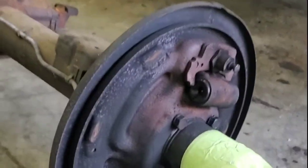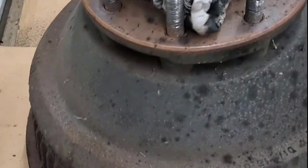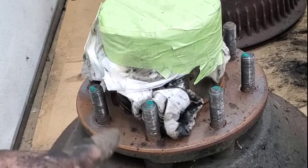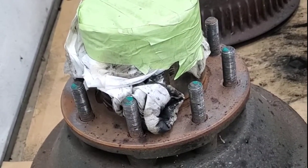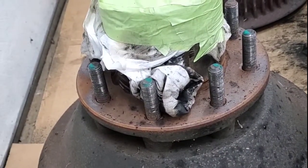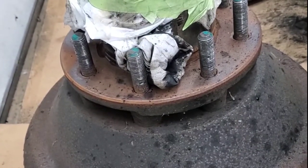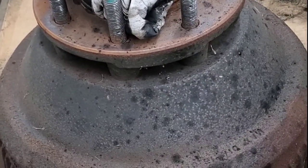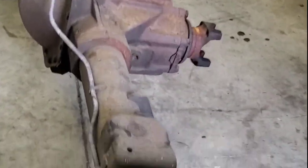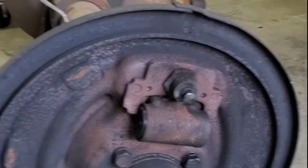Another thing is I needed to replace a wheel stud on the drum. And this is a Dana 80 — it's either a Dana 80 or a GM 14-bolt, I forget. But the way that it's made, it's got the full float axles, so everything is integrated as one — the drum with the hub. And in order to get the wheel studs off, you need to pull this all apart anyway to get the wheel stud out. Once you pop all these wheel studs off, the hub will separate from the drum. I think I'm going to get these powder coated because you'll be able to see them through the wheels.